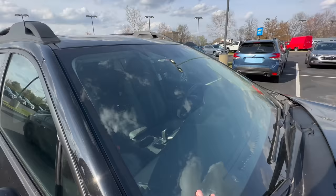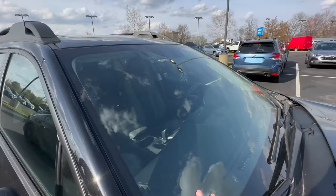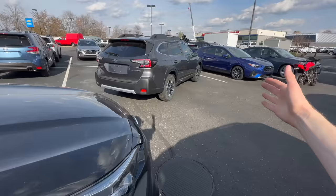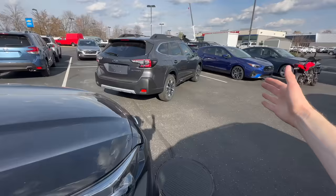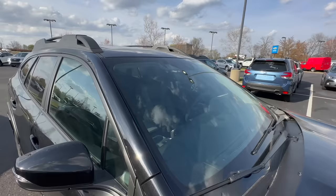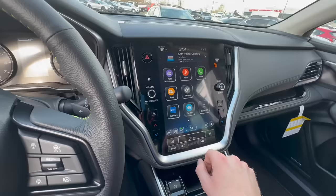If you drive across toll bridges or highways where you need a transponder, a lot of transponder companies recommend putting it in the center of the windshield up by the rearview mirror. But with Subarus, they have cameras up there — two and sometimes three cameras that look for objects ahead and detect cyclists, pedestrians, and cars to operate the emergency automatic braking system and adaptive cruise control. Anything on the windshield could interfere with that and turn it off — it'll say EyeSight off on the dash. Put your transponder in the top left or top right far corner of the windshield instead.